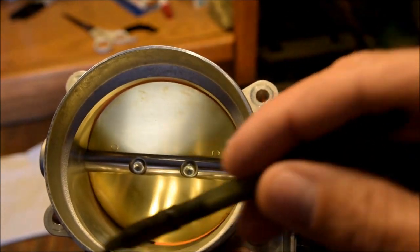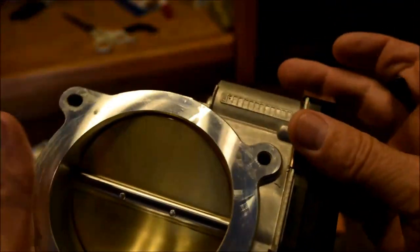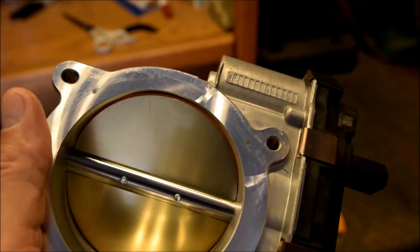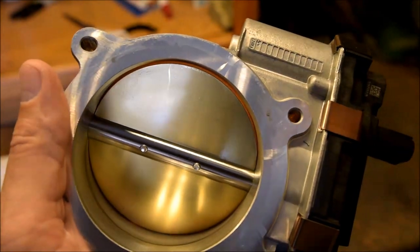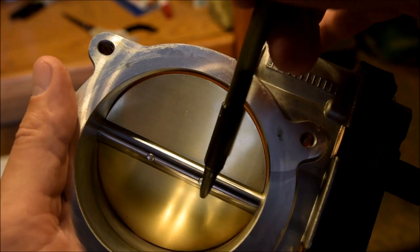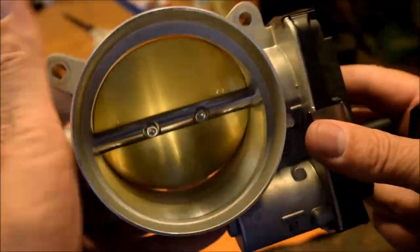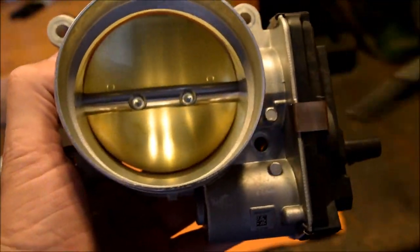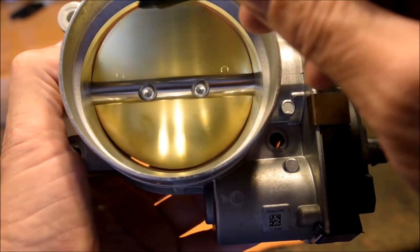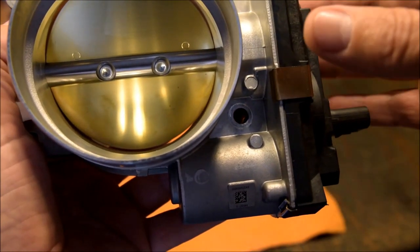I can ease this transition all the way up to here pretty easily on both sides. On the back side, I'm not going to mess with much of this because as you can see it seals here — if you change it, you're going to change the airflow at idle, and you'll be buying a new one. But I can smooth this shaft down and half-shaft it to gain some flow right there. We'll ease this transition about half of it, maybe a little further, because the blade doesn't come into play until right at the very top, so we can mellow this out quite a way. Then we'll half-shaft the back of it.